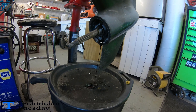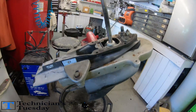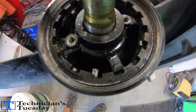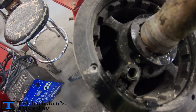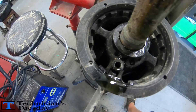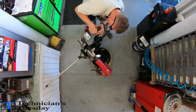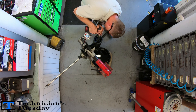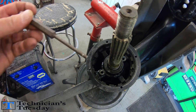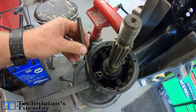We start out by draining the gear lube, and then since this is a 5.4 gear case it will have what is called a torpedo ring that covers the gland or spanner nut — whichever name you call it is fine. There's a little allen head bolt that locks it in place. It's a 3/32 inch head, but most of the time for us in salt water they are corroded in place, so we just drill them out.